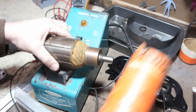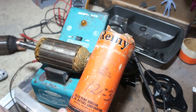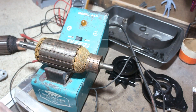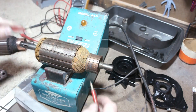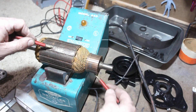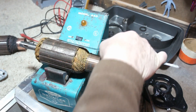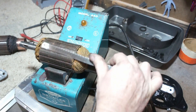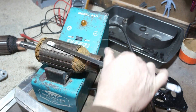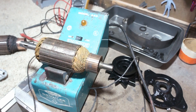This is a new old stock one I bought off eBay. It is the correct part number for the application — 1921-235. Again, we can test for armature grounding — it's fine. And we can use our blade. And we got silence. So that's a good NOS armature and we'll throw her back in.